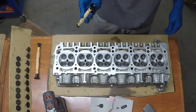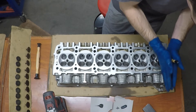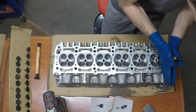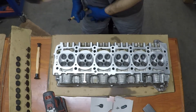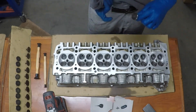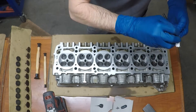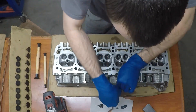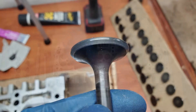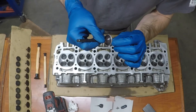Apply light pressure down and run the valve lapping tool back and forth in your hands until you start to get a high-pitch squeak. Then lift up, push back down — you'll hear the grinding sound go back to grinding, then start to go to a squeak. Lift up and go back down, and keep going. Do this a couple of times, especially on the exhaust valves because there might be some pitting. Also especially if you tagged the valve seats with sandpaper when you were porting. You want to stop grinding at a point where it's making a higher-pitch squeak instead of a grinding sound and feeling.